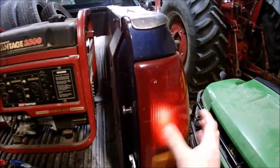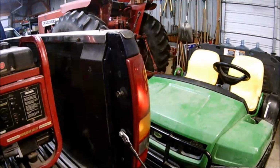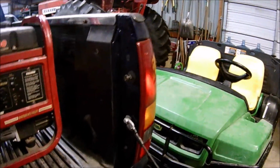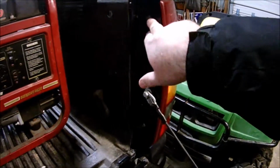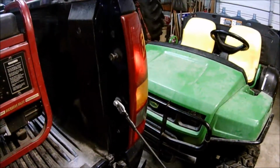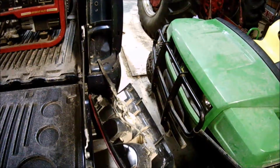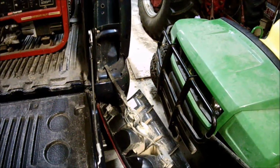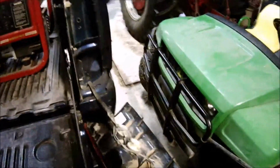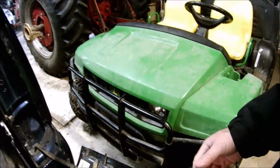And of course, to pop this tail light assembly out, as most of you already know, two bolts, two screws there, Phillips head, and this comes right out. So bear with me. And then someone would say, voila, there you go. Anyway, so here you go, guys. Get your tail light assembly out.